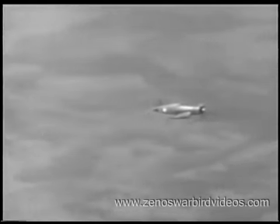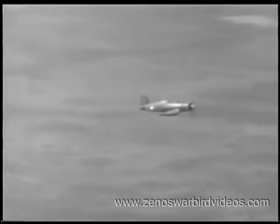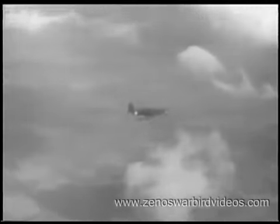Use a partial power climb if the tactical situation permits — around 135 knots is about the best indicated speed. The cylinder heads have a rather high limitation of 260 degrees, and this should be used with caution. Oil temperature shouldn't exceed 95 degrees.